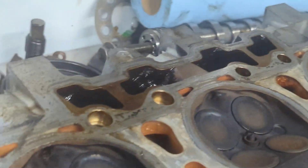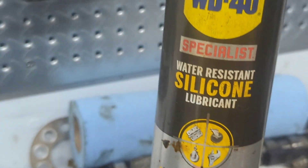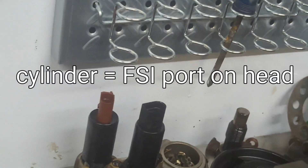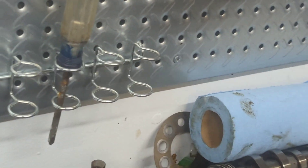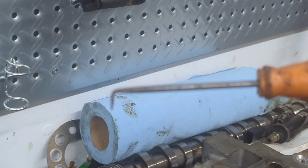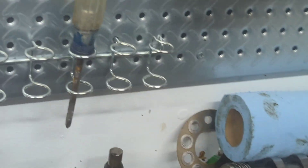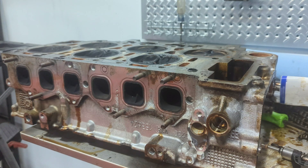If the head was still on the car, my recommendation — though it's probably too late if you're watching this video — is to spray a little water-resistant silicone lubricant into the cylinder before you do this, just to get things moving. I couldn't figure out how to pull it out otherwise. You'd need something like a 90-degree pick here, but you don't want to score up the head inside the cylinder where the injector sits. You might need a longer one — I think you could find some at Harbor Freight. Let's go ahead and try to show you.